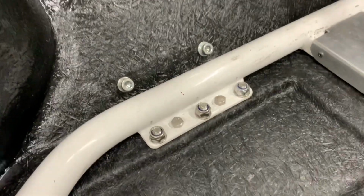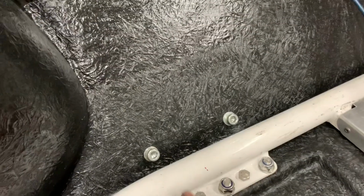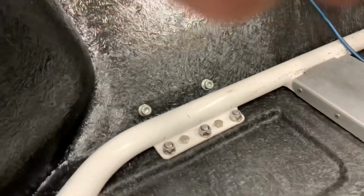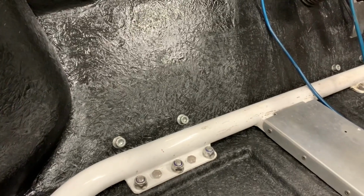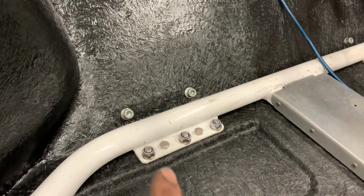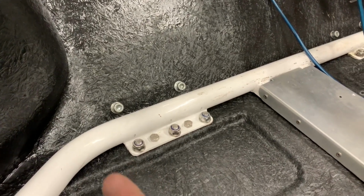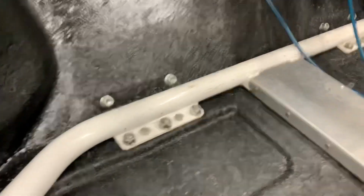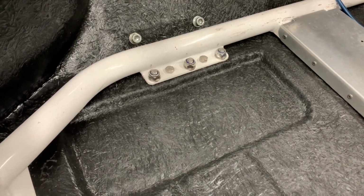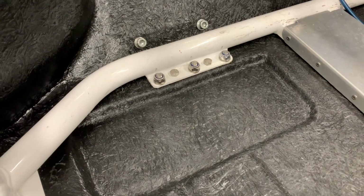So it's a trick for most people. Normally you'll put the Allen key bolts facing down because they look all pretty. When you're bolting a frame or a floor or a chassis together, the main point is you want to put the bolt coming through, because it's easier to see a nut that's disappeared than a bolt in a hole without a nut on the bottom.